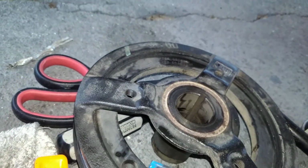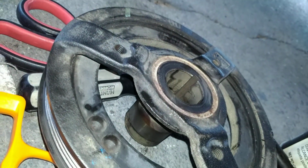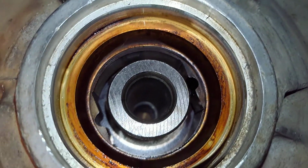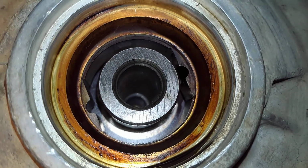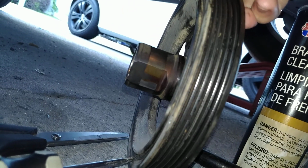Like I said, I took this and crammed this piece right here, right under this lip, after freezing it in place. Pulled it out and just tapped it with a hammer very slowly, and it just came right out on its own. Very, very simple. It really doesn't take any torque at all. It's just a little tight. Getting it back in there is pretty easy. And you want to make sure you align it correctly with those two flat-ended parts for the crank. I guess it's the crank flywheel that's in there. Because this piece here, it does have two flat spots on it for that, very specifically.